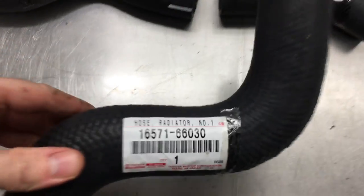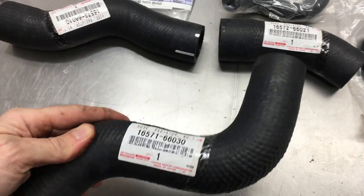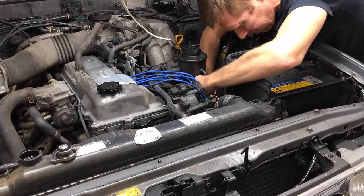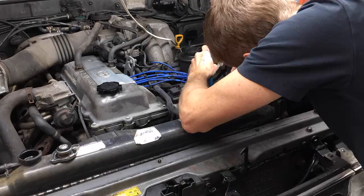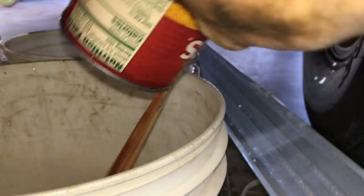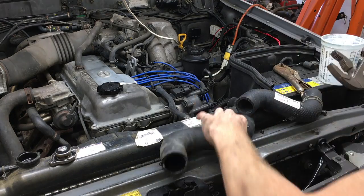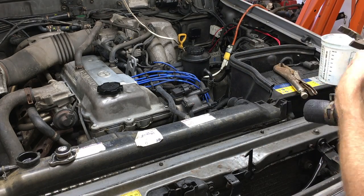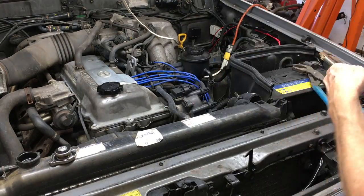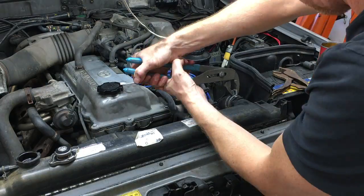While that drains, let's take a look at the first hose. I'll type all these part numbers in the description for you. I got these from Witt's End because they sell them as kits. I started with radiator hose number 1 and used vice grips to release the factory hose clamp up top, but ended up needing channel locks to move the lower clamp because of its location. A soup can was perfect for catching the rest of the coolant. I put a little coolant on the openings to help the hose slide on, and the top of the hose needed a little more coolant to slide all the way onto the radiator neck.